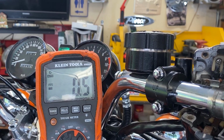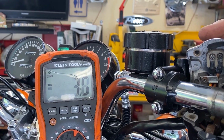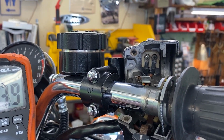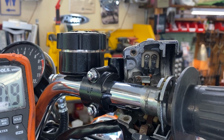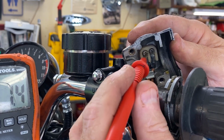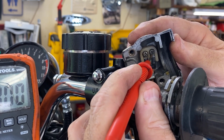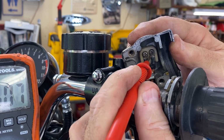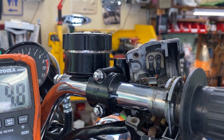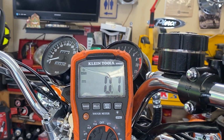So what we had was essentially a voltage drop from high resistance because of the corrosion up in this thing. That's what you have. So this is a really, really good example, and I'm glad I caught this for you, of typical diagnostics on an old motorcycle. You check one thing, don't just go off of that one thing. Check the terminal directly to it because that bypasses the connection. And that's when I said, oh, I know what this is. Now you'd probably find it anyway when you went through and just retightened everything, because that would be good practice. But this way you verify it.